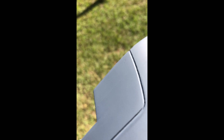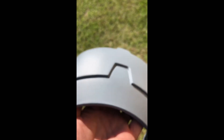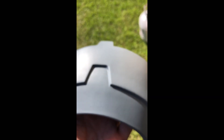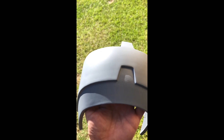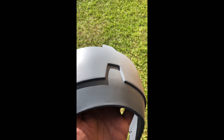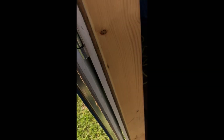We just have some really minor blemishes up top. So we're going to start sanding these with 400 grit, get another coat or two of filler primer on, then move to 600, and these should be ready for paint pretty soon. It's been freaking windy here — even in my shed with the door open, crap blows in. That's why I only primer in here; I don't paint in here. We'll get all these dried and then start sanding them, and hopefully get some paint on these pretty soon.